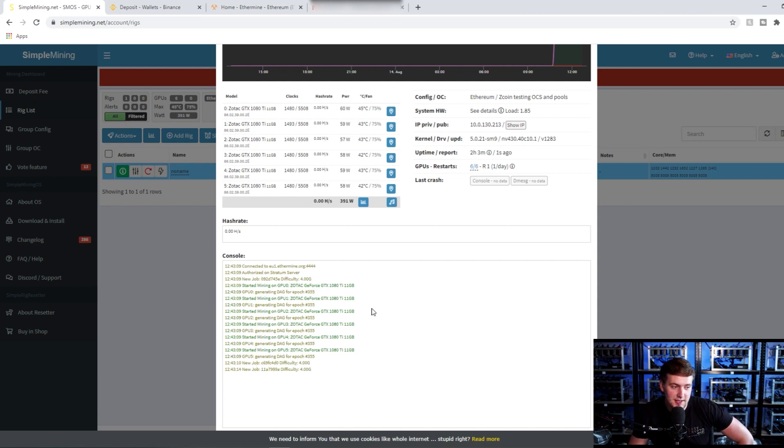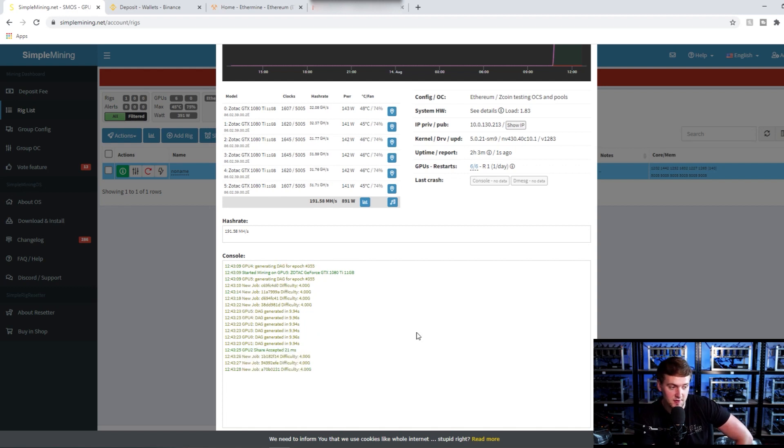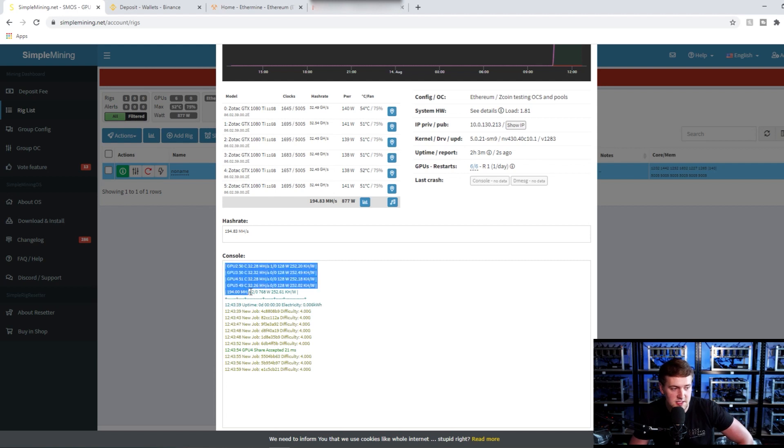On your console you can see it's just loaded in. When it starts to say started mining on GPUs, it'll be generating the DAG — that just means it's finding the correct files and starting to mine. The first sign to check when you've swapped over is that you've still got all six cards, because on some switchovers there can be power fluctuations that knock out cards — very rare but it can happen. Check six out of six. Then you'll see GPU zero to five start producing a speed — your megahash at the bottom — so you've confirmed it's mining.